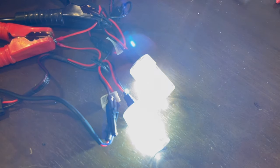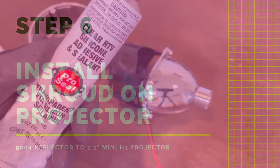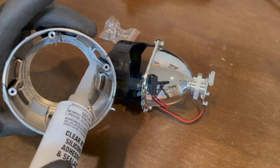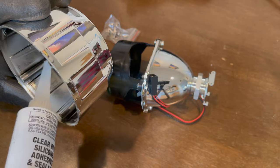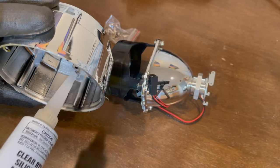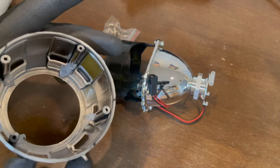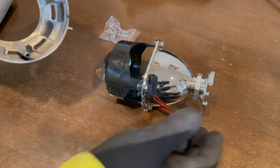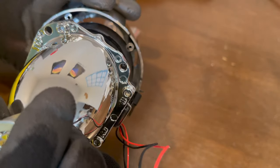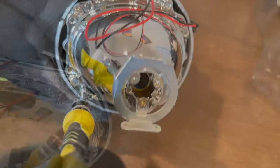In step 6, we want to install the shroud onto the projector. I used a clear RTV silicone adhesive because it has no deformation, a favorable amount of tension, light viscosity, good flowability, and high temperature resistance. When something is inside your headlights, you want that temperature resistance from cold to hot — that's why I chose this RTV. I applied it to the four corners of the shroud, placed the projector into the shroud, then used the four screws that accompanied the projectors and made sure they were tight.